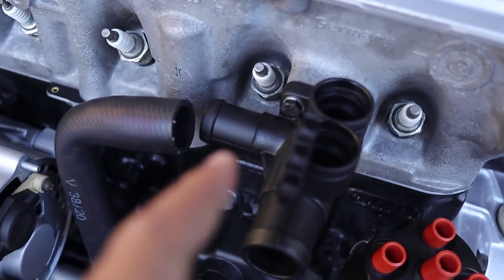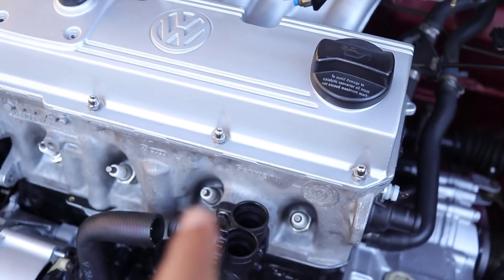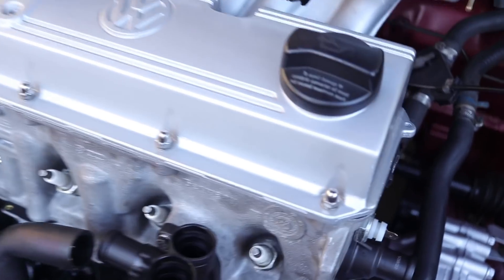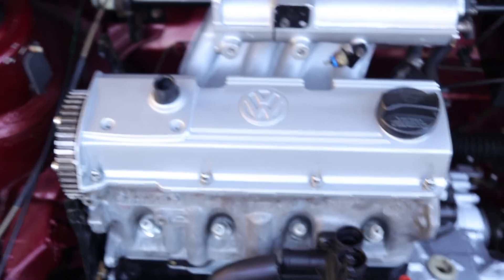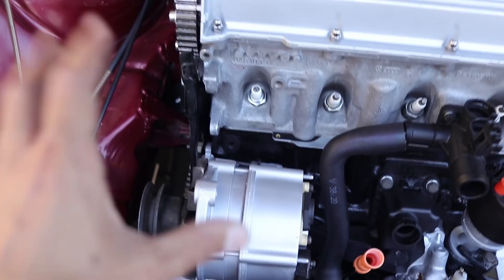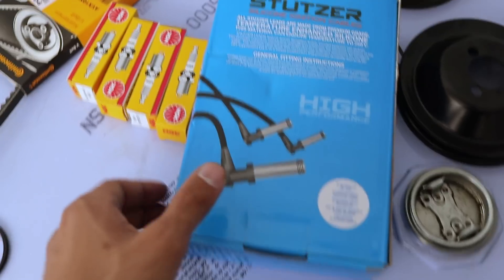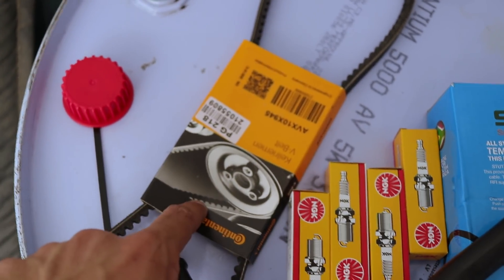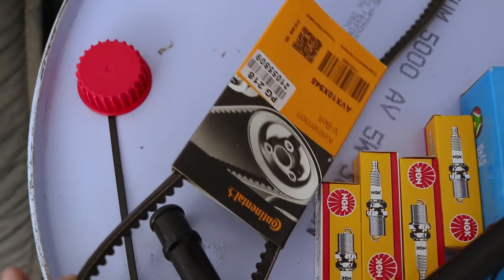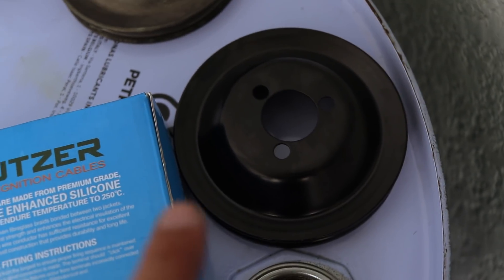So I've got these two flanges, and I also have some other flanges in the engine bay. I got some new hardware — some black hardware — for this one and also for the side flange. I also got these nuts for the tappet cover. It's probably not everyone's cup of tea but I just want to put a bit of my own touch to it so it looks different. We're going to fit the bracket for the alternator, put in some new plugs and plug leads, and fit the belts. I had to swap one belt out because the original was too small, and I also got a different pulley because the previous one was slightly warped.